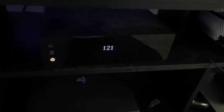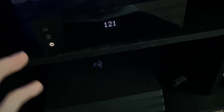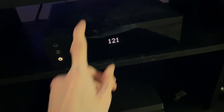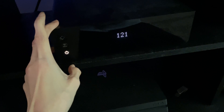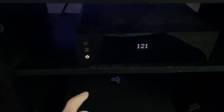That will pretty much resolve the issue. Quick disclaimer: it will reset your network settings, so if you set your own SSID and password like I did, it will reset to factory default — the Wi-Fi the box shows on its own will be default and you'll have to set that up again. Also, for the mini boxes, you'll need to do the WPS button setup again after you do this.